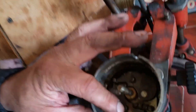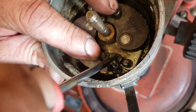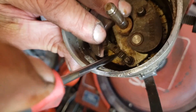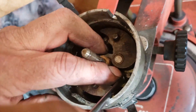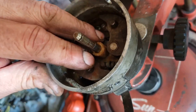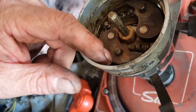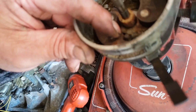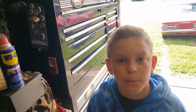I don't have enough in there yet in my opinion, so I'm going to tweak this twice more — in two places. Just give it a tweak. You can see the tweak in there? Look how much this allows it to fall away. That's taking centrifugal advance out of the distributor. This should hopefully get our centrifugal advance in order — we shouldn't have as much advance as before, and it should advance a lot faster.